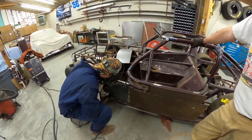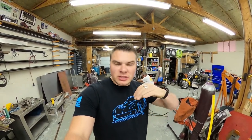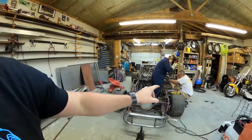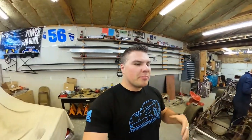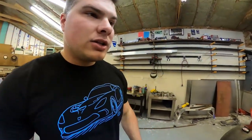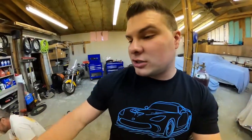Part of the process on this dash is that we've got a custom format to our shape because the body is kind of rounded. What we're doing is tacking each individual little section along there one at a time, then forming it with those tacks. When we're done, the tacks hold it in place, then we're going to have some silicone behind it to seal it, because this metal is too thin to do a consistent weld across. Every inch we're hitting it with a little tack — we've already done this one side.